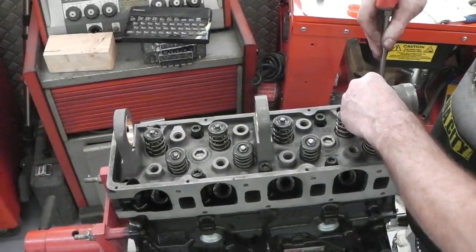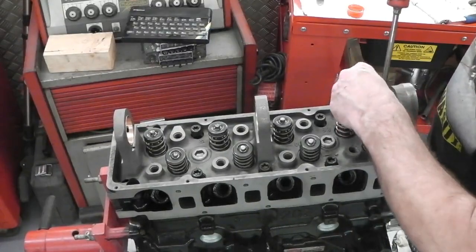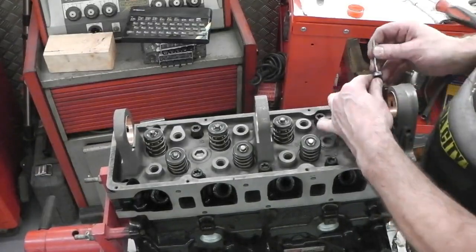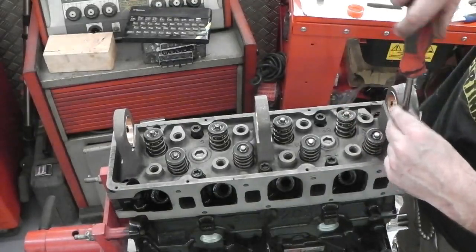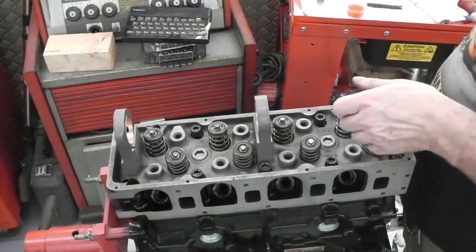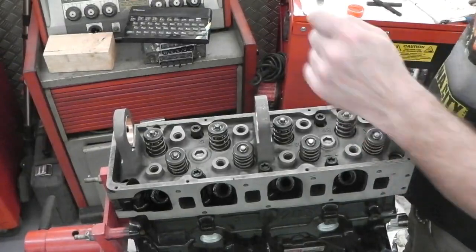Magnet might not be quite powerful enough to do it. I would have thought that magnet would have... Oh yeah, I knew it would. Right, of course it will. You can make these guide bolts, just use old head bolts, grind them off. They make life much easier.